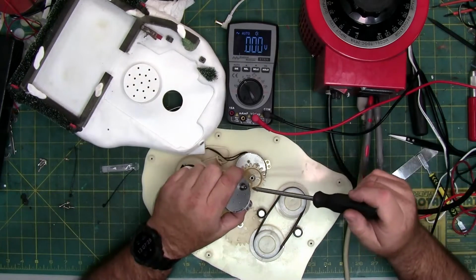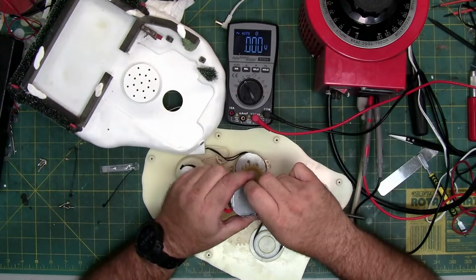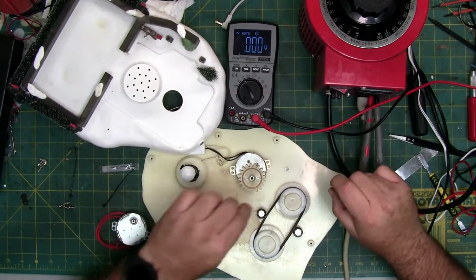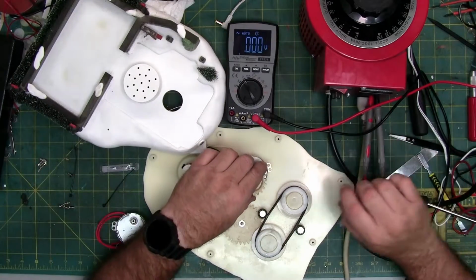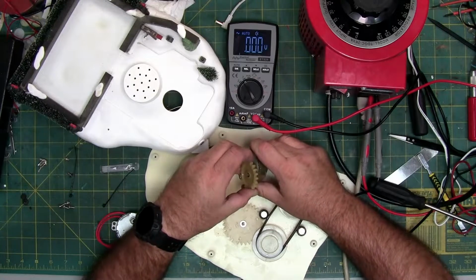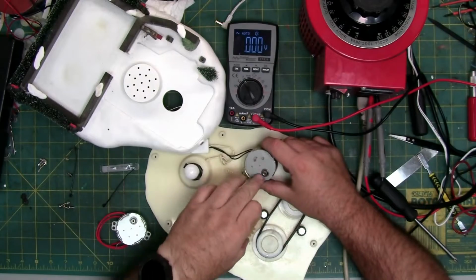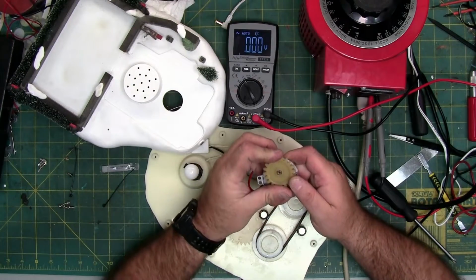This comes with a screw, but this screw is not the same head. It's recommended you use the original screw. So I'm going to take this screw out and this lock washer. Set those aside just to make sure because I want to verify. And then this is a double flat keyed gear. You'll be able to see. Hold it up closer. So you got to kind of walk it off because it's a tight fit, but it should fit on here just fine, like so.